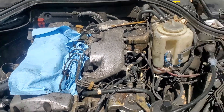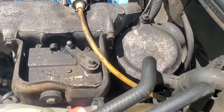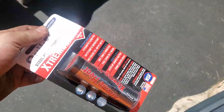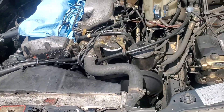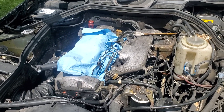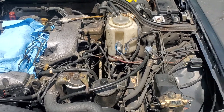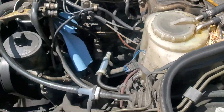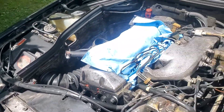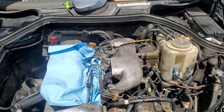Hopefully we'll have a good running car after that. I should mention — I think I mentioned the throttle broke last time. I'll give a close-up here again so you can see it's held together with zip ties. I got some high-heat JB Weld quick steel and I'm gonna wrap that around so it's a little bit better than zip ties. The zip ties have held up great, but I want something a little extra — because if the zip ties break, they're holding the plastic together, and if I lose one of those plastic pieces I won't be able to reattach it.